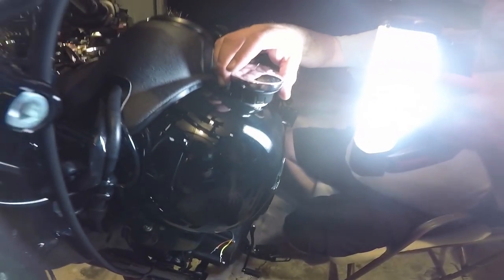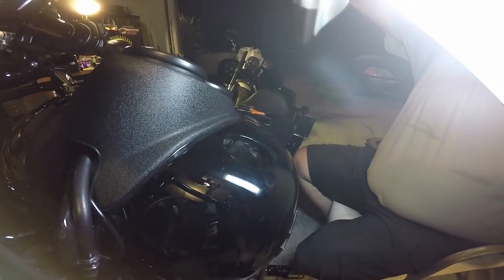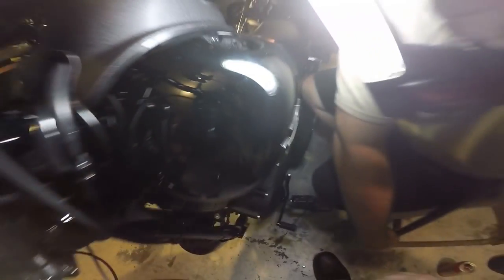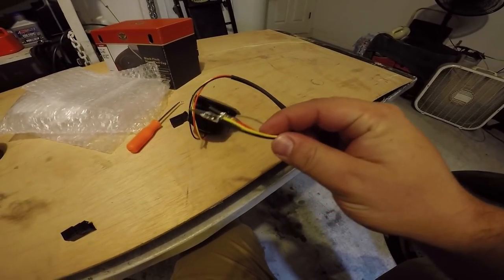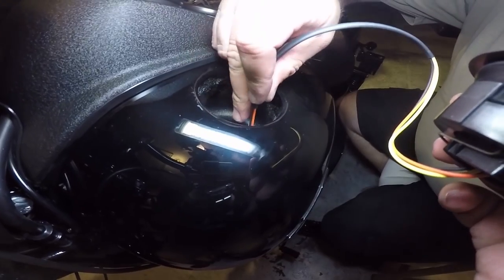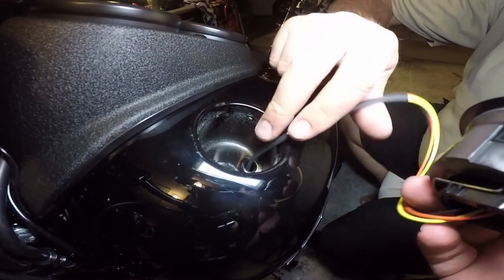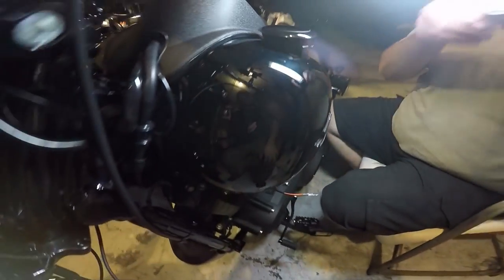Pull the back piece up to free the wire so it's not clamping down on them. Remember the orientation: orange, yellow, empty space, then black. We got all the wiring off the harness. Pull this cap up — should come right out, you see the wires there. Bob's your uncle, that's it! Slide the new one in and it'll be mad sexy. Slide the wires through the hole.